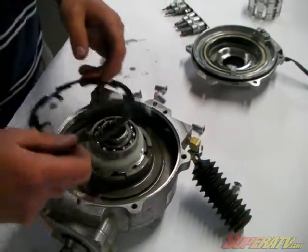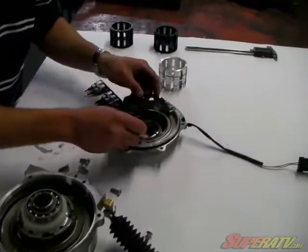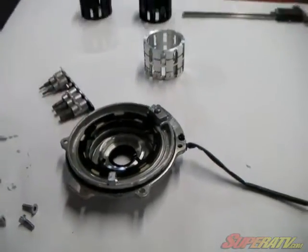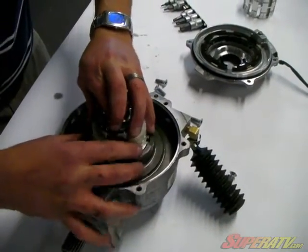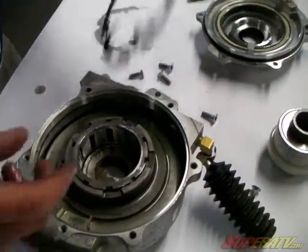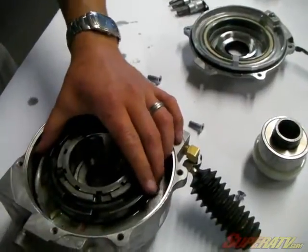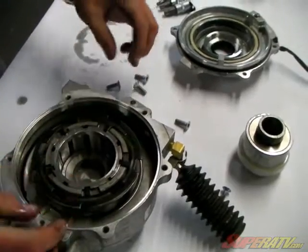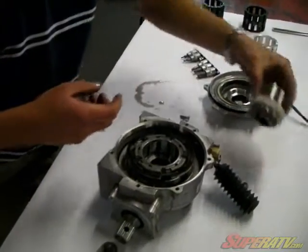So when you hit the switch on your 4-wheel drive, it energizes this magnet, and this causes enough friction on this to cause this cage, which if I take this out here, maybe you can see that this will actually stop this, and as you go to turn, that advances enough that this comes down and wedges on this journal here, locking it up, causing your 4-wheel drive to work.